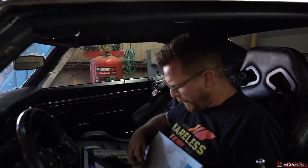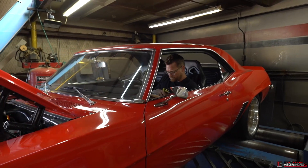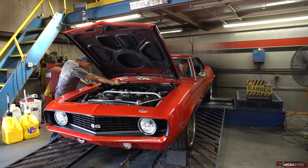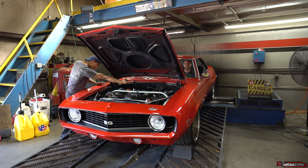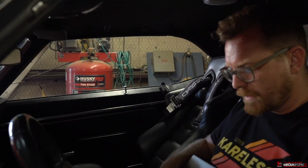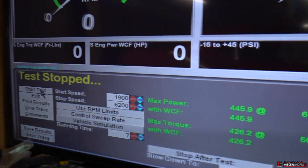There we go — there's a nice little bump. I'm going to add a little bit more fuel in, but it actually felt like on that run there was very little response to my last fuel add. Although we do have a sensor on the fuel rail, I'm not getting the log here, so we may have to physically watch the one on the gauge. That fuel add — that serious add — that did the trick. Tiny bit more power, but now safely so.